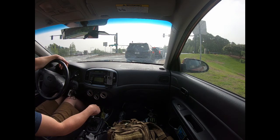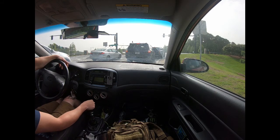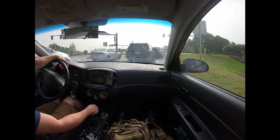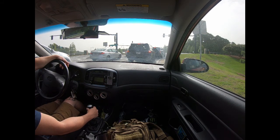But honestly, it's kind of surprising the way the spring rates worked out with chopping some springs, flipping leaf spring packs upside down, throwing the helper underneath, and then lifting it up 2 inches. But I can go over all that. I'm going to take the bed off, so it'll be easy to see the rear end setup, but we'll see how that goes, and I'm going to go into work.